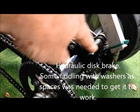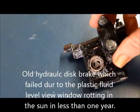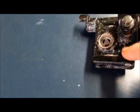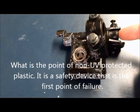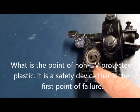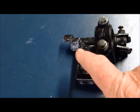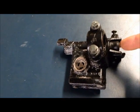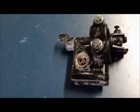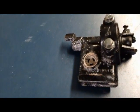I had some trouble fitting the rear wheels and finding small ones — they're actually six and a half inch on a six-inch rim. I put some rubber in here to make it lock in, and it also has to be tube, not tubeless. There we've got the electric motor — 11 sprockets to 64 sprockets on the rear sprocket. Over here we've got a hydraulically operated disc brake. Here is the old hydraulic brake handle — it's got brake fluid in it. What happened is this viewing hole had plastic on it, but within one year the plastic wasn't UV protected and just rotted out. The fluid leaked out and the thing ended up seizing up. My new one I'll just be taping up with black cloth tape so the sun doesn't get it.